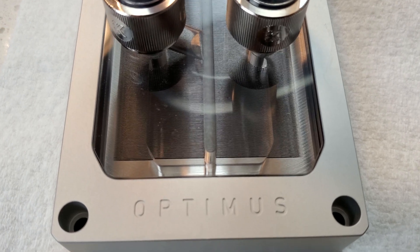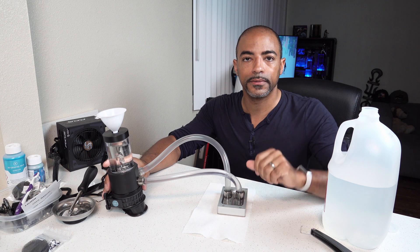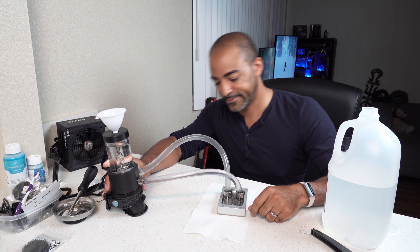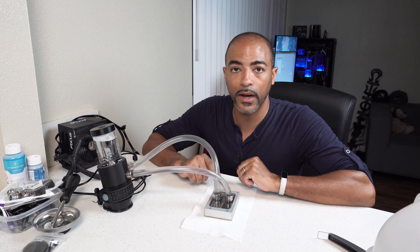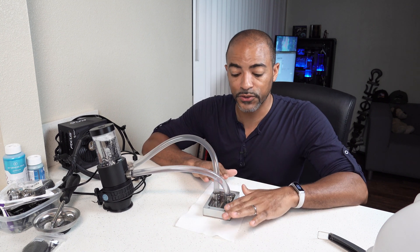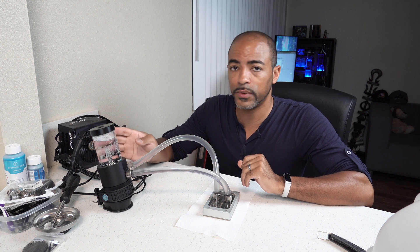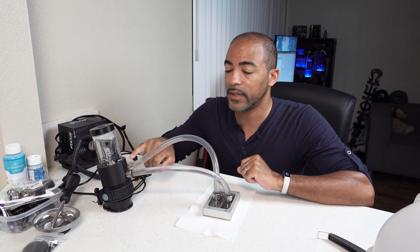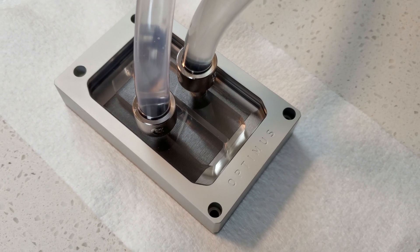I will come back in about a half hour and see how this looks. I have a paper towel here so I can tell if there's any leakage. All right everybody, we can call this a win. This has been going for over an hour now and there is not a single sign of any leakage whatsoever. This is actually kind of hot because this is a D5 pump by EKWB - D5 pumps do tend to run kind of hot, so you have to make sure you have good airflow in your system. But they're very powerful pumps and incredibly silent as well, so this is actually my favorite pump right now. This Optimus water block - so far, so good. I really, really like the design of it.